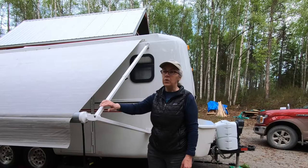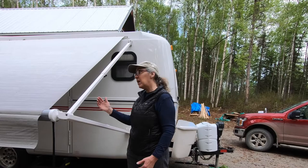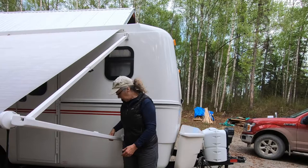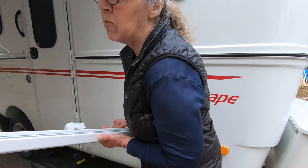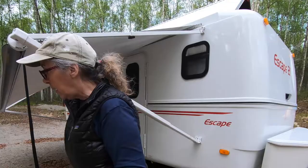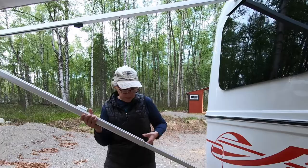Now that you have your arms out, you're ready to move your awning up. If you've got two people, great — but we like to put it up about halfway on one end and halfway on the other and work our way up. You don't want to exceed a complete 90-degree angle because that puts pressure on the top. Pull the lever out; it has a little knob that catches one of the holes. Come up halfway, lock in the other side, about halfway. I like to grab the arm rather than the handle so I'm not putting pressure on that part.